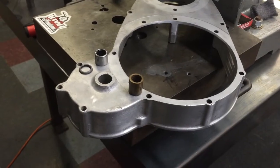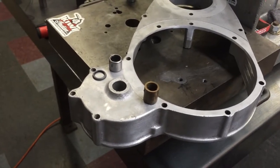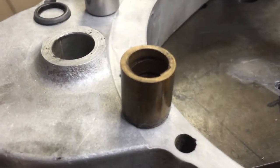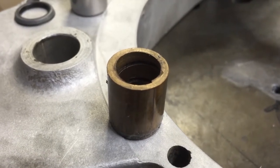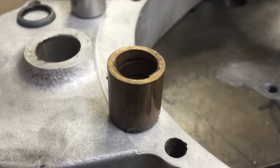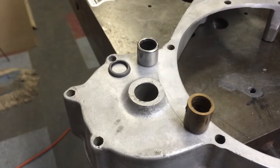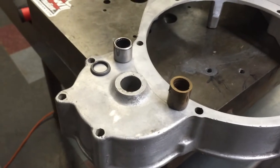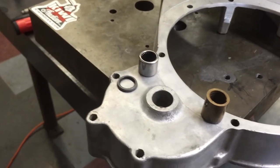Here we're going to show the installation of the generator drive bearing and seal, and the inner primary cover, which is an upgrade from the original bushing. The original had a bushing in here — you can actually see there's a helical oil groove in there. If you do decide to use one of those, which you shouldn't, just make sure those grooves are going the right way. One of the manufacturers made these grooves the wrong way. As the shaft is turning, it's pulling all the oil from the inside of the primary out. There are quite a few people with those installed that are experiencing oil leaks, and it's quite a major job to redo it — you have to pull the whole thing apart.